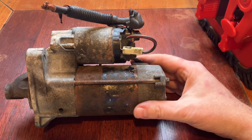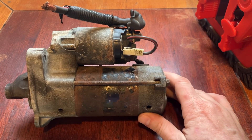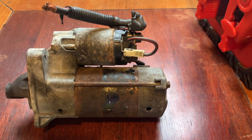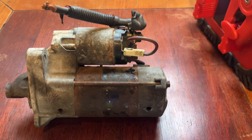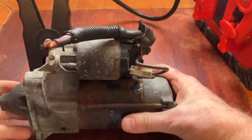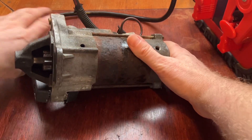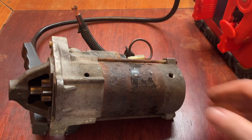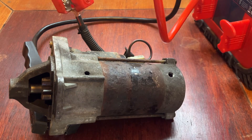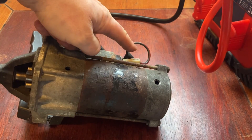How do we test one? Quite easily really. The starter motor is bolted to the engine and the car has a body earth, so somewhere on the engine there'll be a return wire back to the chassis and back to the battery. I've got a battery pack here - all I'm going to do is clamp the negative onto the body itself to get a good contact, and then the positive onto the wire to replicate the battery supply.